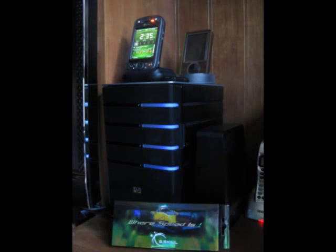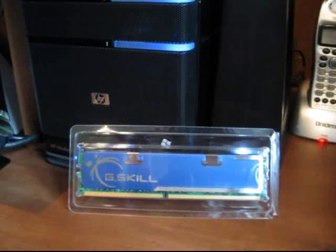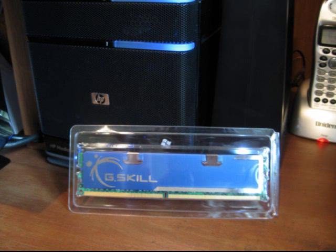We've got our home server back into place. We plug everything in in the exact same spot that it was — Ethernet, any USBs, and your power. Give the power button a little push and then we probably have about 60 seconds of nervous hard drive activity, and then your console will go green. Log back into your Windows Home Server, click the settings button, and then go down to resources. As you see on this screen, you should be able to see under your home server 1.97 gigabytes of RAM. Now our home server has a little bit more room to breathe. Don't forget that you also need to do a virtual memory modification — I will have a link to that in the show notes.